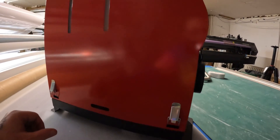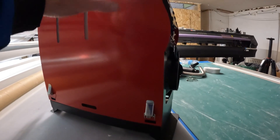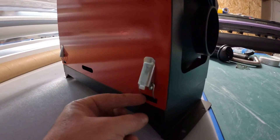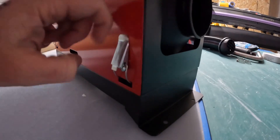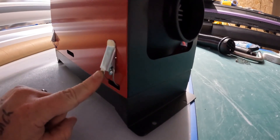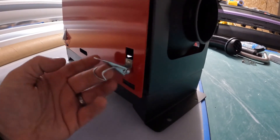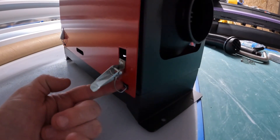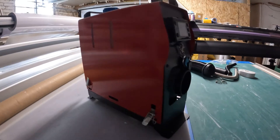You might have to get into some little nooks and crannies with your screwdriver, so it's easier to do this next part if you take this lid off. You've got these four little latches here which connect into the chassis of the heater. They're not very easy to get off — it's really difficult to get your fingernail under there. There's a little tab just here: if you push down on the tab from the top it should loosen off, and then you've got this little tab that fits in this little socket just here. Go ahead and do that for the rest of them and then we'll get the unit on its side.